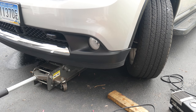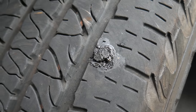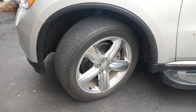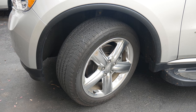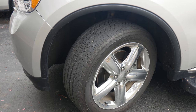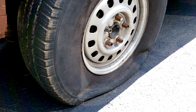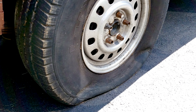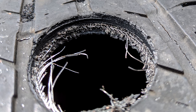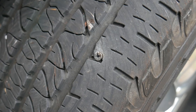And well, that's it. We'll drop it down and remove the floor jack, and the Durango is once again ready to hit the road. Ideally, I would probably let this sit for at least an hour to make sure the rubber cement has cured. But if you were on the side of the road, I'd imagine it would be fine to drive it right away. This particular plug was only in the tire for around six months before the set was eventually replaced due to age, and there were never any signs of leakage or other problems related to the plug. If you end up with a pierced tire, it's a very good idea to get it taken care of right away — not only could a slow leak turn into a rapid leak, but moisture could work its way in and get to the steel belts in the tire, potentially leading to rust and eventually a blowout.